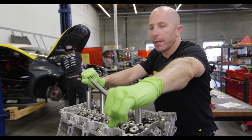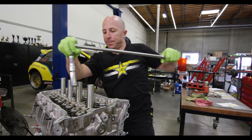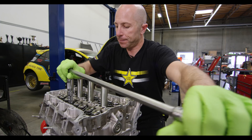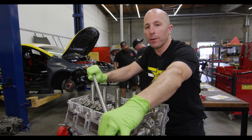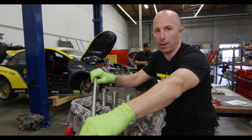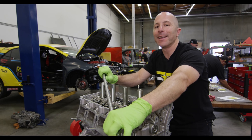These are torqued really high — somewhere between 145 to 165 foot-pounds — and they're half-inch ARP custom 625 studs, pretty gnarly custom studs. The issue with these engines is always the head gasket; that's the weak link. We've gotten to the point where we're not worried about stretching studs — we actually yield the head, the head will actually flex up. We're working on fixing that problem, but it's still in the works.